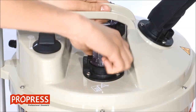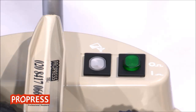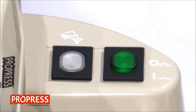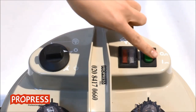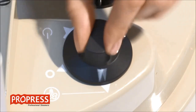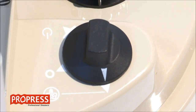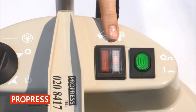Replace the filler cap. Next, plug in and turn on your ProPress. If using the Pro 290, push the on-off switch down and it will illuminate. If using the Pro 580, after pushing the on-off switch down, you will need to rotate the energy regulator to the steam position until it clicks. The steam indicator light will illuminate.